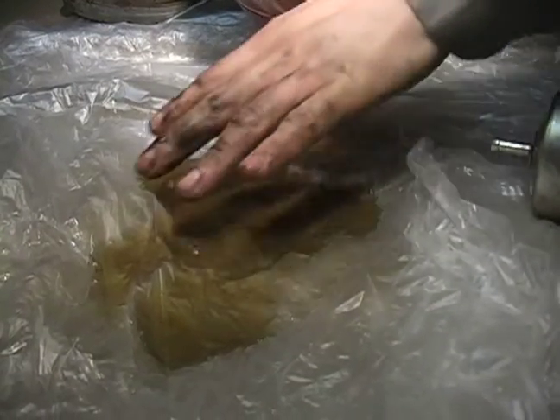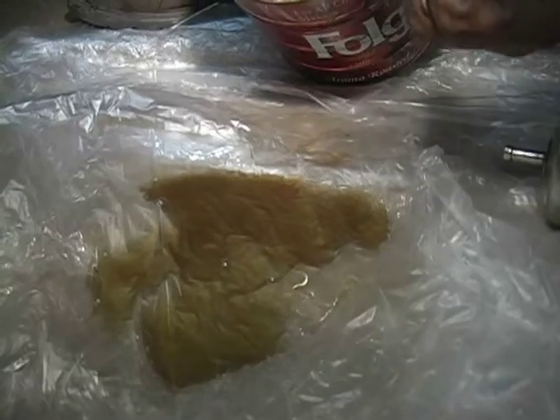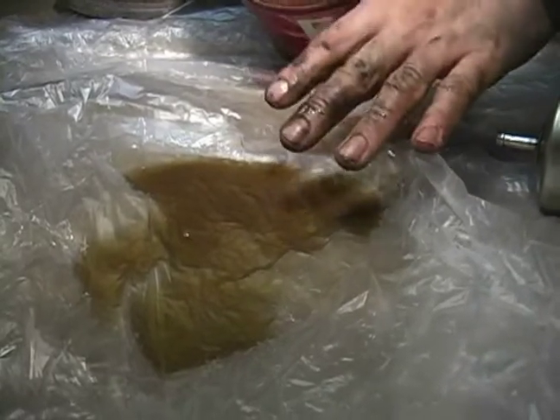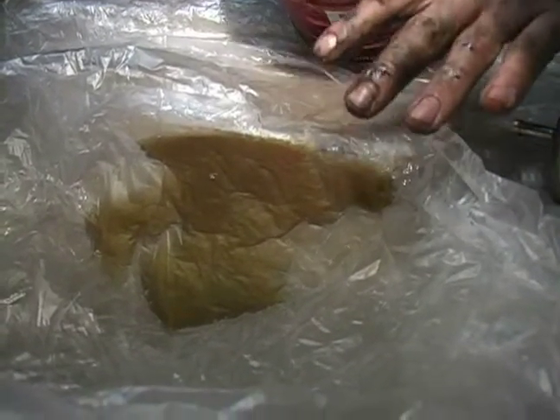As you can see, this is not even really near clear. It's not the nice amber, maybe even a bluish color that gasoline should be. This is more like iced tea or coffee — it's highly contaminated, rotten fuel. This wouldn't make it through one trip in your engine. This would actually damage or destroy your fuel injectors.